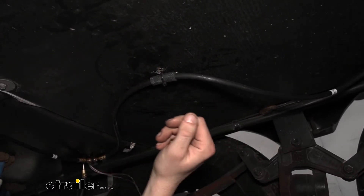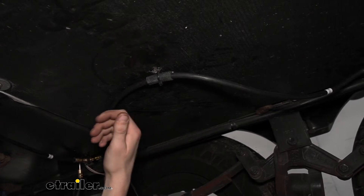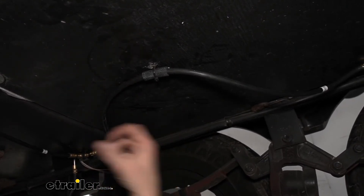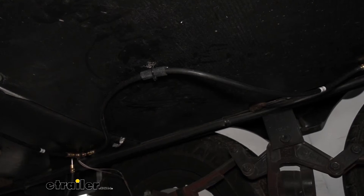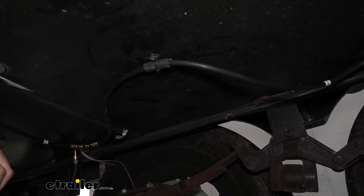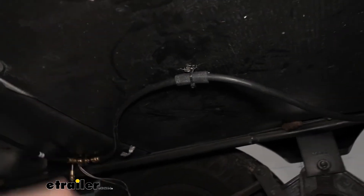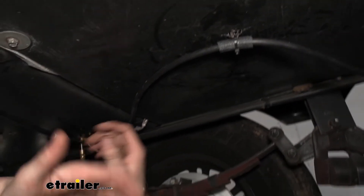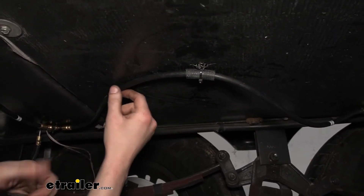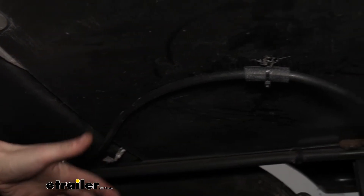This hose kit is rated for enough pressure for both a drum hydraulic or disc hydraulic system. We're using it for an electric over hydraulic conversion where we removed the old drum assemblies and converted to disc, and this just saves a whole bunch of time. In my experience with trailers going to disc brake setups, disc brakes require higher pressure than drum brakes. The 1600 psi coming out of the actuator for these disc brakes is really hard on metal lines when it comes to getting them to tighten down properly. The fittings on these flexible lines just seem to seal a lot better — I'm not having to torque down so hard to maintain proper sealing at high pressure.